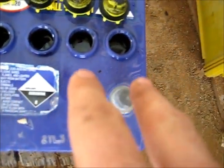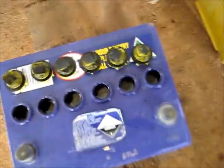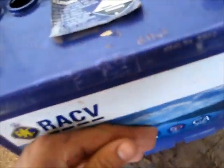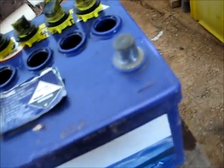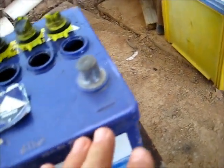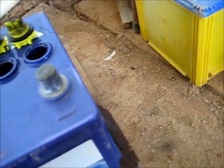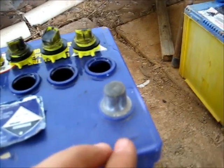The desulfator did repair the battery, but as I said, it's these two cells — they're way too far gone. I don't think it's going to crank an engine. It's just too hot on this side of the battery; it's too far gone. That's my conclusion on this battery. The battery is actually charged, but it's just these two cells. It did actually live, but not really. Thanks for watching.